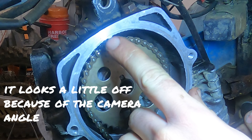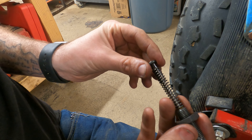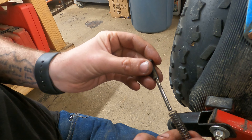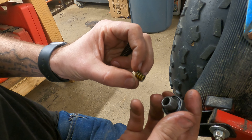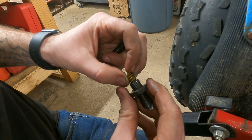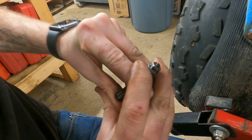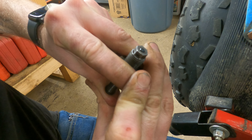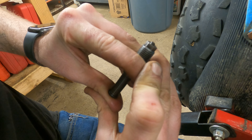There's a little casting that needs to line up with a timing mark. I'm going to explain how the chain tensioner works: there's the actual pusher, a main spring, and a small yellow spring inside. The plastic cap goes on top and seals it all off. If I squeeze the pusher all the way down, I can see how much protrusion there is — when that little tit is flush, I know there's at least that much play for the chain before it bottoms out.